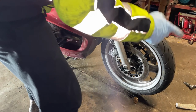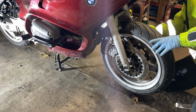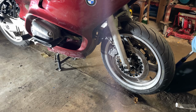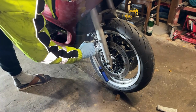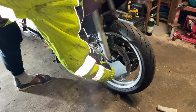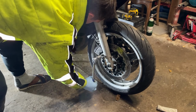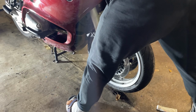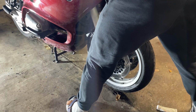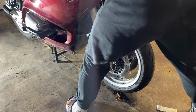That's what I want. Now you're going to torque them holding the brake. You just need a different torque spec. It's 40. Turn the wheel. Use the brake. You hold the brake lever. You torque them both. You keep the lever in and you do the other side. That's it.